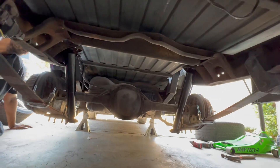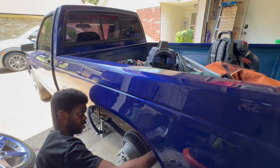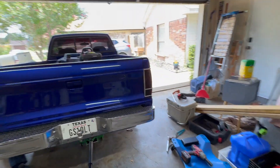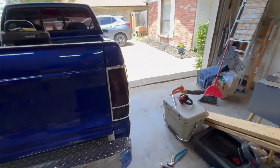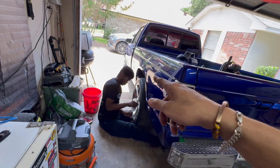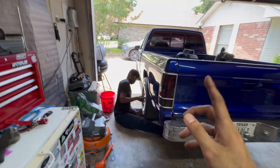All right guys, now we've got all new shocks — super, super stiff. Hopefully it rides a lot better. Now we're going to cut the inner tubs. A theory we had was the truck was too low and the tires were too aggressive, hitting the fender. But because these shocks were so bad, the truck sat so low and it was hitting the inside of the fender. Before we start cutting anything — see how you can see where it was rubbing? Because before it used to be almost fender to tire, so we might be like an inch or two above now, but we're not fully sure until we check it out.